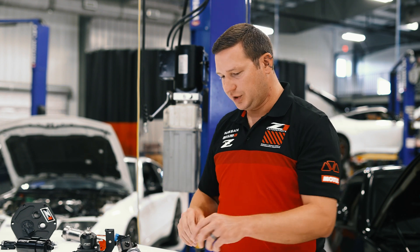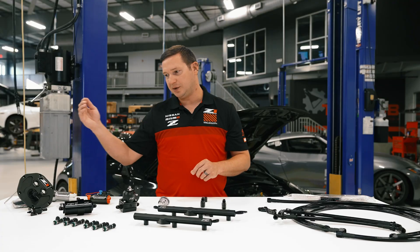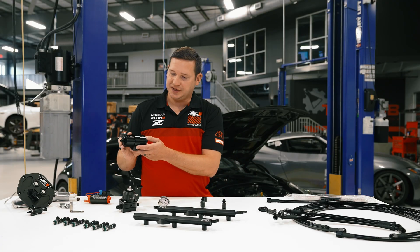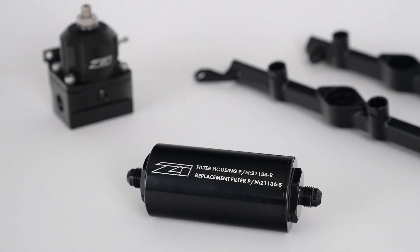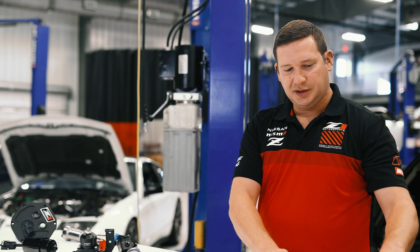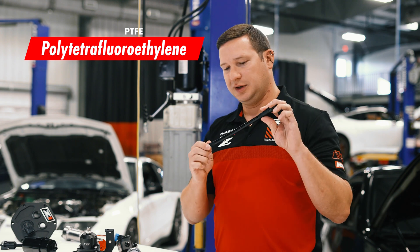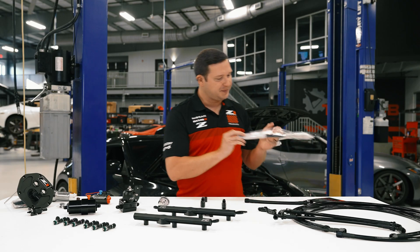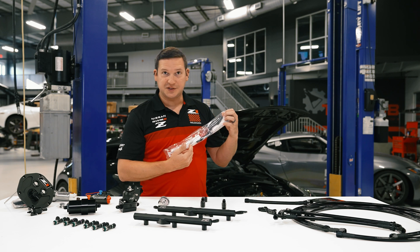Once we come out of the tank, we're going to use one of our fittings to come off of the bulkhead and run under the tank to our E85 compatible stainless steel fuel filter. This is serviceable — you can actually unscrew it, service and clean, or just replace the screen filter. We're going to come on up with these PTFE stainless steel and PVC coated lines up to the engine bay. In the kit, each line will be individually bagged and labeled specifically with its part number.